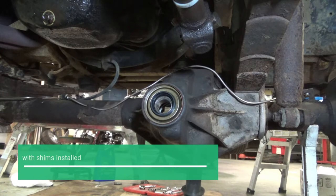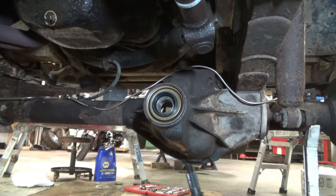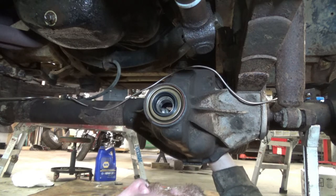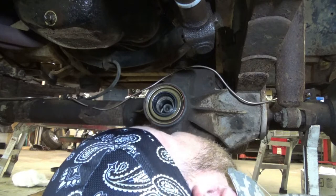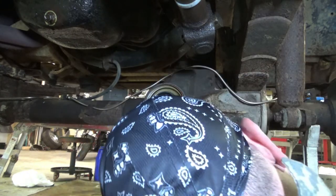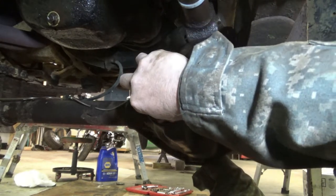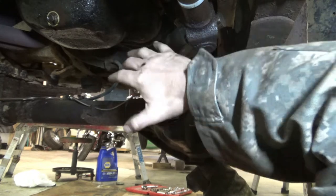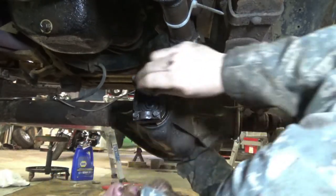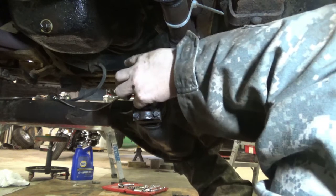All right, the new pinion. Now this isn't going to fit the whole way through quite as easily as it had before. It's actually going to press fit into the new bearing race slightly. Yep, like that. See? So what we're going to do, apply our yoke. Make sure. Alright. Well, I'm going to use my old nut real quick. We're just going to draw this guy through. Oh, hopefully, if I can get enough.